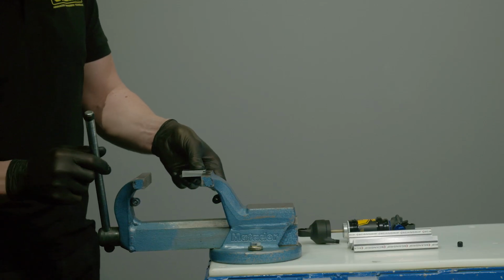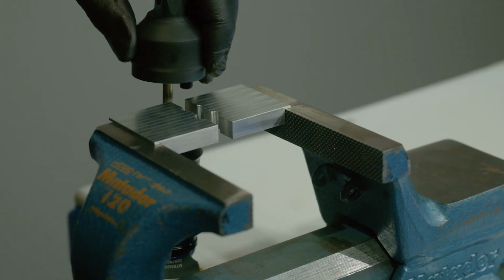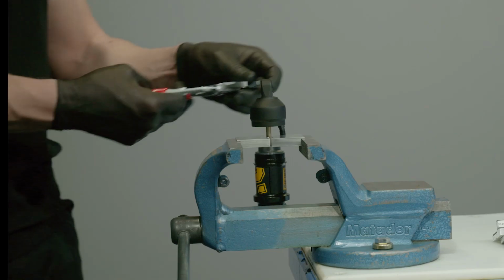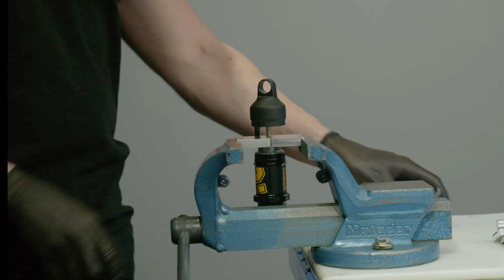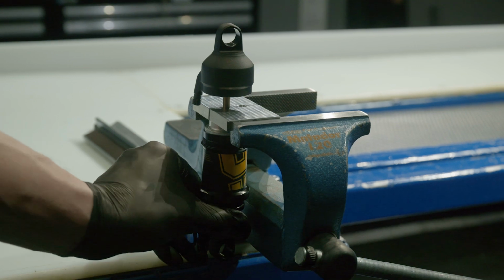Turn the shock upside down and clamp the shock with the special 6mm clamp tool. Loosen the end eye using the special tool together with a 22mm open spanner or deep socket. Be careful not to damage the valve when turning and reclamp if needed.